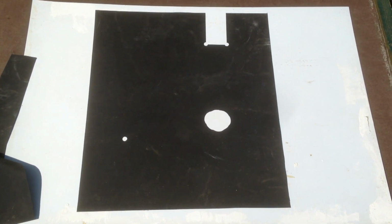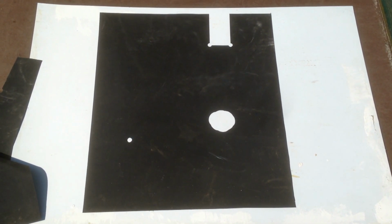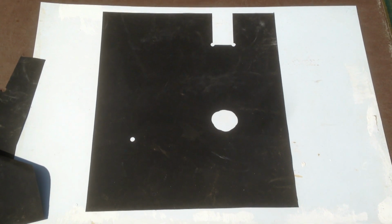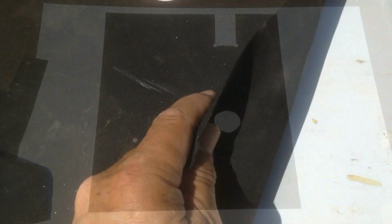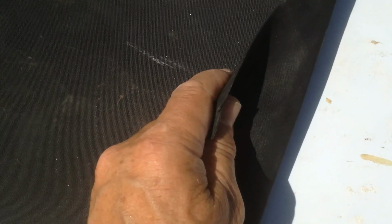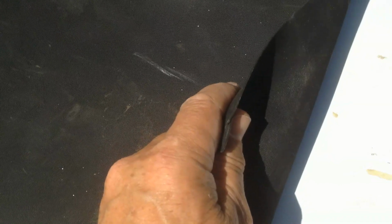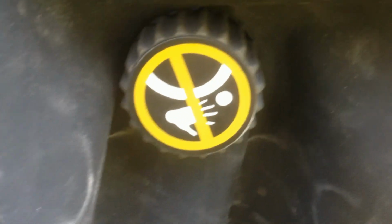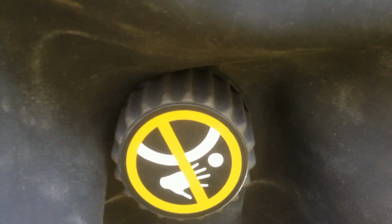This is one of the two covers I cut from the fish pond rubber. I cut a large hole for the roller that will be driving the tire. You should not use the cheap PVC lining for fish ponds, but the more expensive EPDM rubber variety. It can be bought at any fish pond shop, or large do-it-yourself shop. Any cuts should be finished with a round hole to prevent any early ripping. You simply slip the large hole over the roller and then slide the rubber further over the mover.